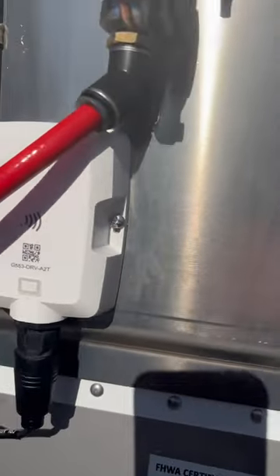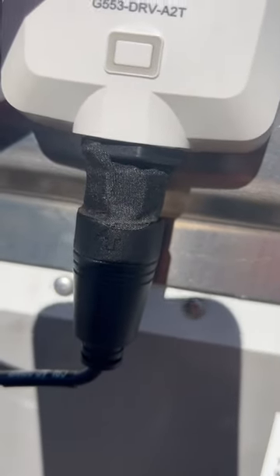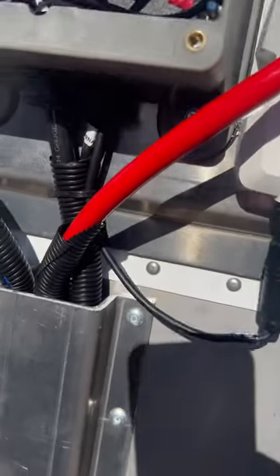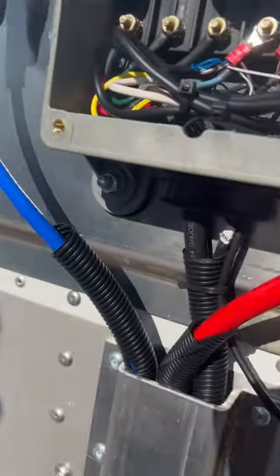We're using a Samsara AG model tracker. What we've done is plugged into the bottom and covered that with tape to keep it tamper-proof. You'll see that this is zip-tied to the electrical, not to the brake line. You don't cable tie or zip tie anything to an airline ever that is carrying electricity.